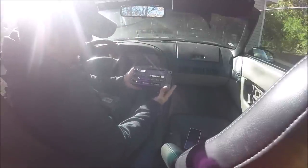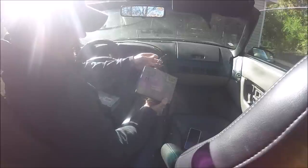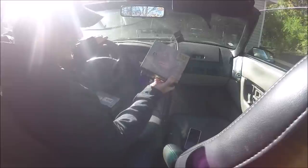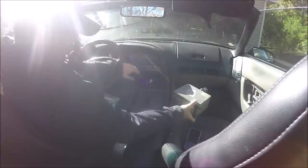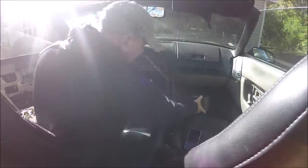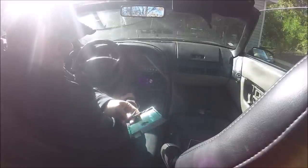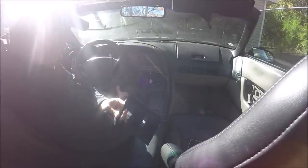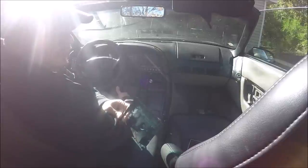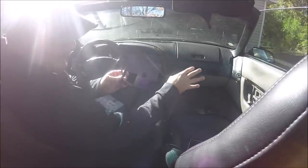Here's the original CDM. You can see this one was trashed. You pull the CDM out far enough to get hold of the two plugs and unplug it. This is actually the head unit, and this thing is heavy — it weighs every bit of 10 pounds. The new Pioneer unit probably weighs two pounds. Once you unhook it, you'll see a plastic piece in the back that will have to be cut out for any normal-size radio to fit. There may be some yellow boxes clipped to it — those are part of the supplemental restraint system, so make sure those don't get damaged or unplugged. Just pull them loose from the clips and push them out of the way.